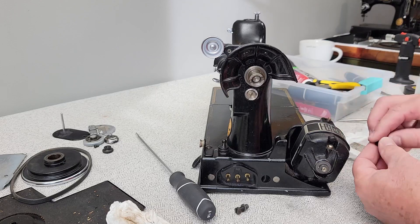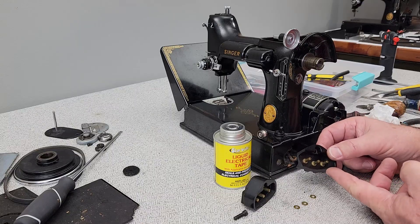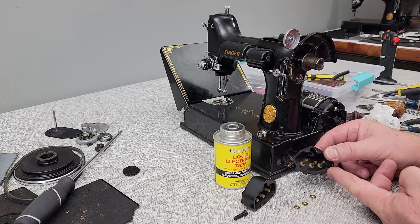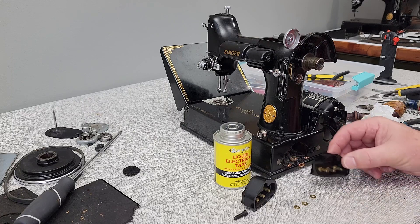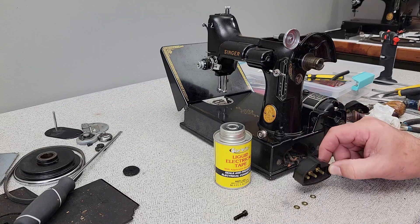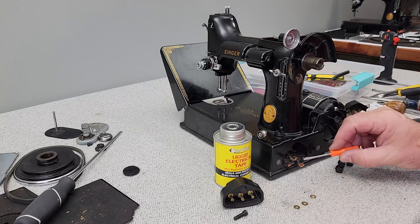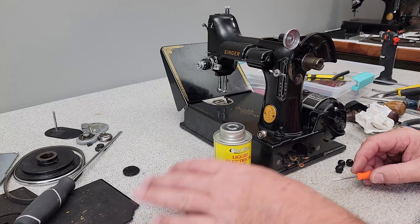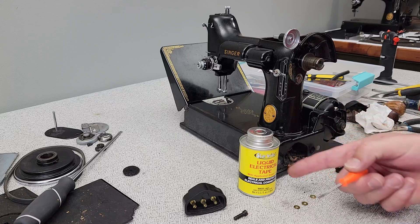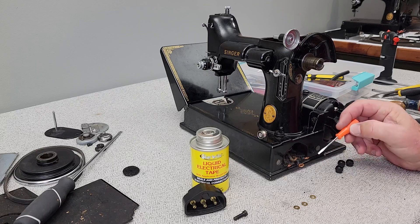Just make sure the shape of this brush matches the armature when you slide it back in. Slide that in and when you put this back, finger tight is plenty tight enough. If you watched my other video on what to look for when you buy a Singer Featherweight, here's an example of one of the chipped junction boxes I was mentioning. I've taken this one off the machine and a good used one will be going back on. These wires were frayed on the ends, so the easiest way to remedy that is to get some liquid electrical tape, put a little bit on both ends, and wait for it to dry — maybe an hour. That will take care of the frayed ends.